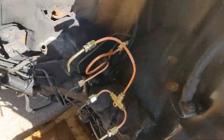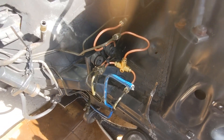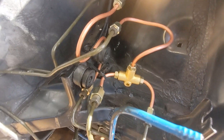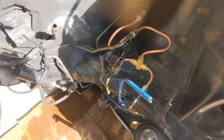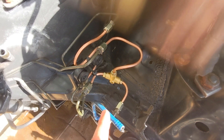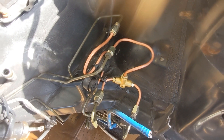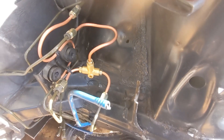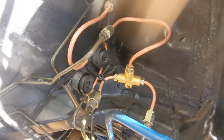Everything's good — I'm going to tighten them up now, hopefully no more fluid leaks. I'm going to brake-clean the whole area, neaten it up. This is basically the final positioning for all of my brake lines and I'm quite happy with how this came out, considering I've never done any brake line work before and there was no kit I could buy that was ready to plug in. Some of my lines are maybe too long, so it might be worth coming back to remake some of them. But I made sure to clean up the area all around and get rid of all the brake fluid using some Halfords brake and clutch cleaner, so it doesn't corrode any of the paint.